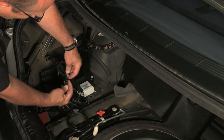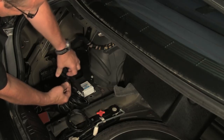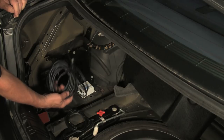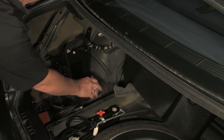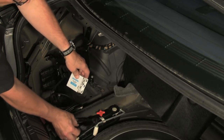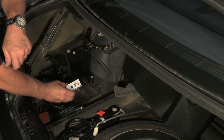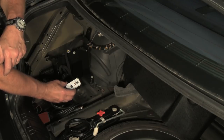This matches our six-pin plug — just pay attention to the indexing on the plug and it plugs right in. And the three-pin plug right next to it is also indexed and will only go in one way. So now we have our connection to our main operation cable, which will run forward in the car. The DIN connector plug will plug into the unit, and the iPod plug will plug in here and go to your iPod.